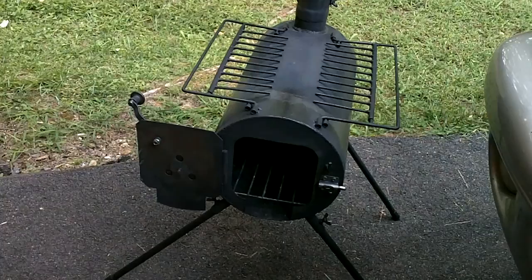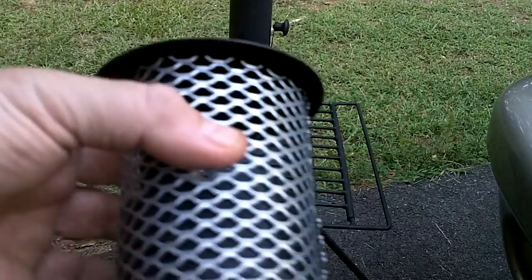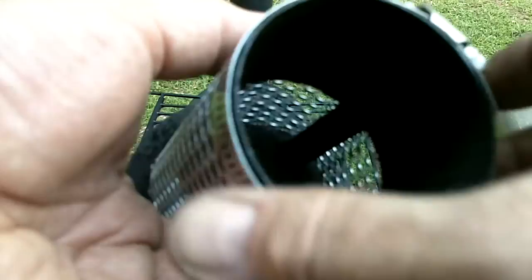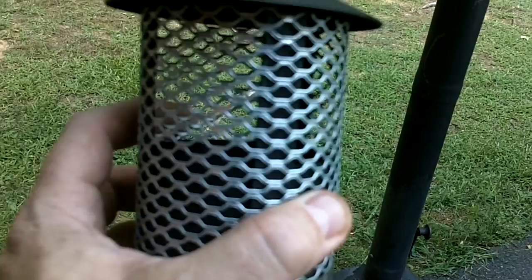It was $4.99 for a three-foot section. I didn't want to recreate an entirely new spark arrestor, so I trimmed it to fit and mounted it along the outside of the existing spark arrestor that comes with your stove. Then I knocked out the centerpiece where the old spark arrestor was — I just put a piece of pipe and took a hammer and banged it out.